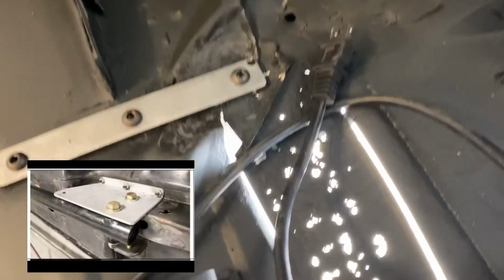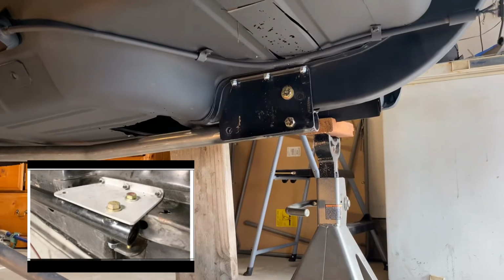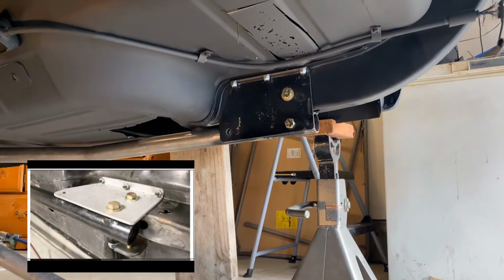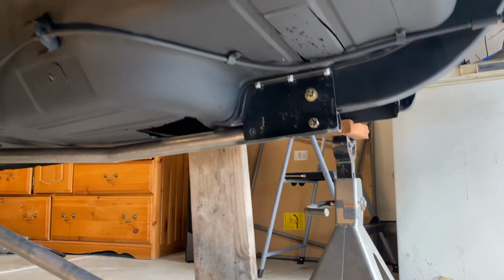Pick 5, page 3 of 14. Bolt alert. You know those 3.5-inch bolts? We're installing it in this picture, but this will not be the last time we see these bolts. We're going to mount the subframe connector front channel to this plate using a 3.5-inch bolt in the bottom hole.